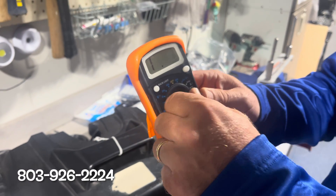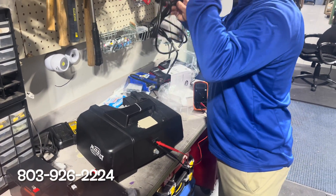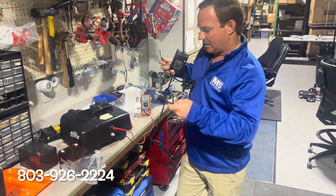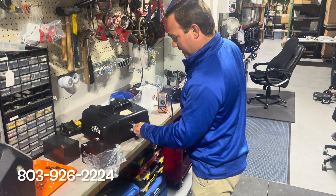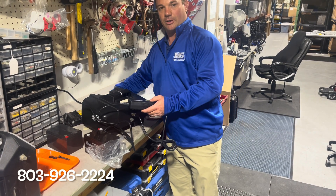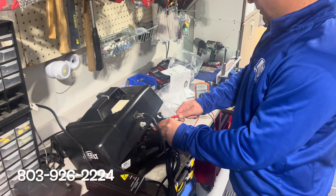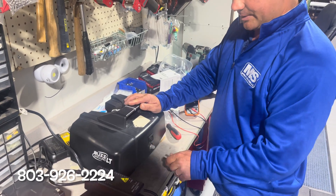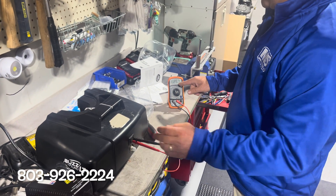See how I had it at 20 — it gives me that reading. Flip it up to 200 and we get 25.4. Let's check the charger while we're at it, because there's no point buying new batteries if your charger's not working. If batteries are really bad, the charger could burn up. So I got a reading at 25.4 — I'm going to pull this out, stick this charger right into it, and plug it into the wall. Remember that number 25.4. You can also check from underneath or put your multimeter right on one of the batteries and see if the reading is going up.